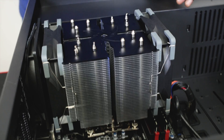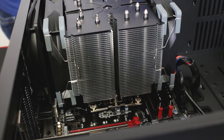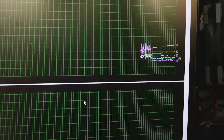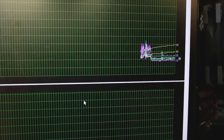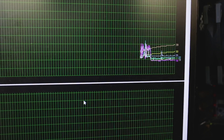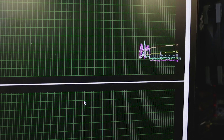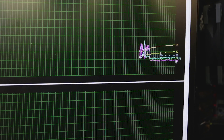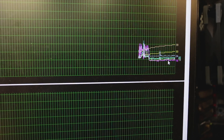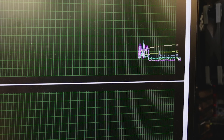Look - I could barely put the side on. Let's go and test it out anyway and see what the benchmarks are. This is the most quiet CPU air cooler I've ever tested. It is so quiet. It's got two 120mm fans and the RPM is about 600 at the moment. That's like a 140mm fan just on its own - it's got two 120mm. I've never ever heard anything so silent. The SSD is hotter than the actual CPU itself, which is ridiculous - it's at 39 degrees. The lowest CPU core is at 18 degrees, then 22, 19, and the highest is 25.